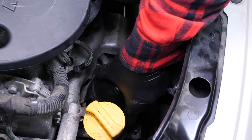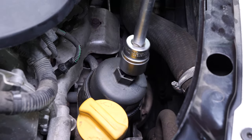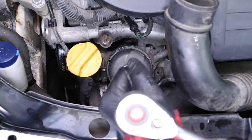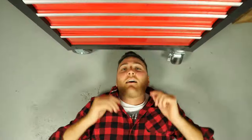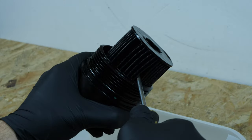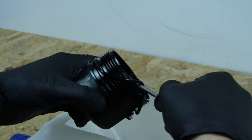Remove the protection cover. You can now access the filter flange. Take a socket wrench, an extender and a 27mm socket. Release the flange by unscrewing it in an anti-clockwise direction until it turns easily. Finish the unscrewing process by hand and remove the filter. Separate the filter cartridge from the flange, levering it off with a flat-head screwdriver. Using a thin screwdriver, take out the rubber oil ring which is located on the flange washer.